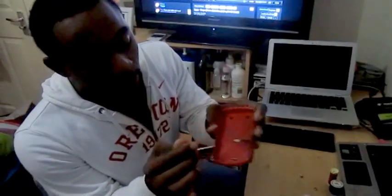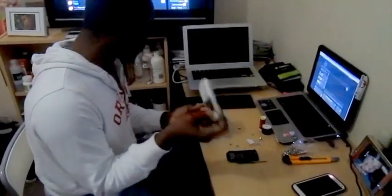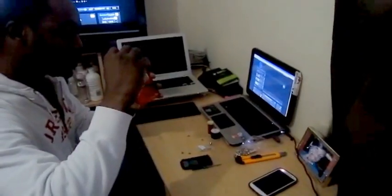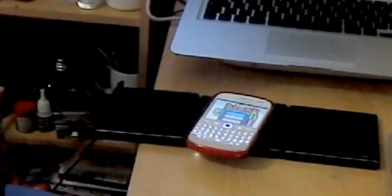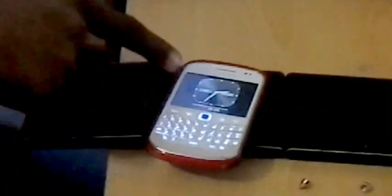You can hear the sound — it means it's charging. Now you've got it all in your casing, you bring the wires out and connect them through your terminal points. This is almost what I can call a universal charger for any Blackberry Bold 9900. What you want to do now is put it in carefully so you don't disturb the ball of copper wires — put it in from bottom to top. Click. Now put it on your mat — can you hear the sound? It means it's charging.